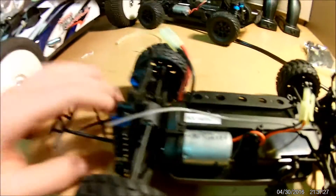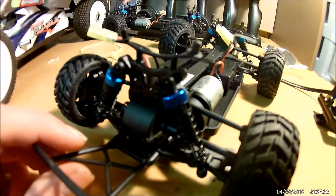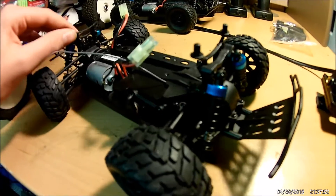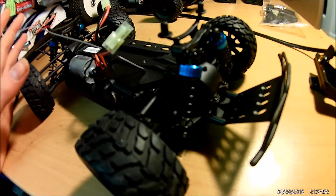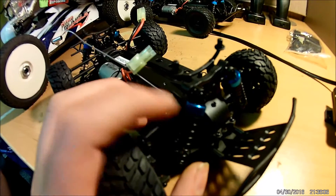Let's take a look at the shocks. These are supposedly oil-filled shocks. You can't expect the truck to do big jumping, so they're small and simple, but they might do a good job. Small trucks are generally quite bouncy anyway. The suspension in the front seems stiffer than the rear, which I'd think would be better the opposite way. The front shocks are also smaller than the rear ones, so you can't just swap them.